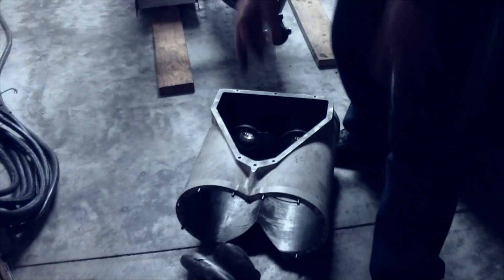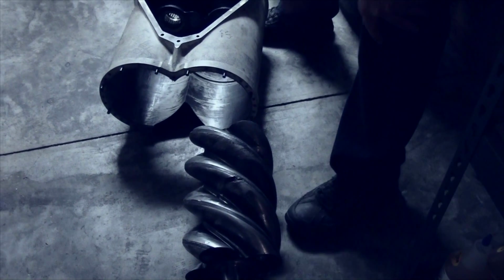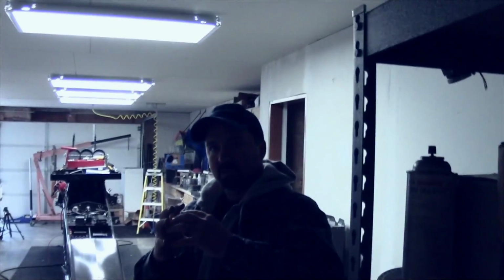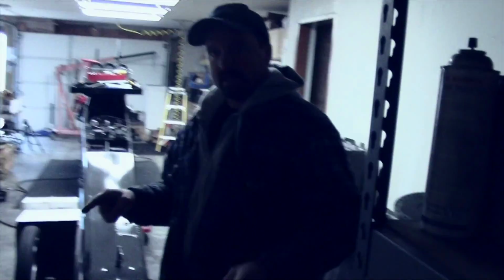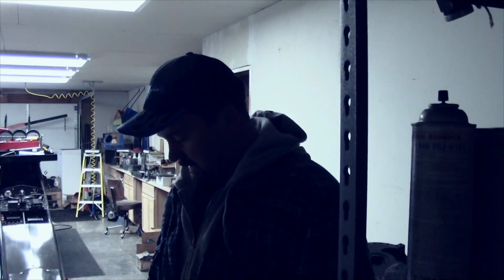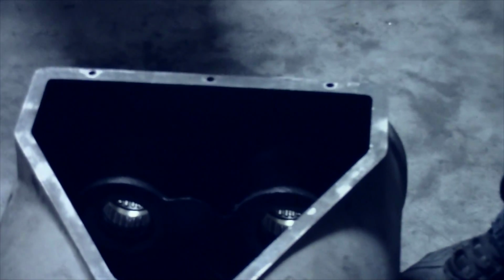That is tricky. And then the other rotor sits inside of it. It's got like 4 and 6 on the lobes. The biggest thing about these blowers is they don't build hot air because they don't actually touch. They don't rub like a roots blower would, with the Teflon rubbing the sides, which builds hotter air. With cooler air, you can build more horsepower, and it doesn't take as much horsepower to turn it, because you can actually spin these over by hand.